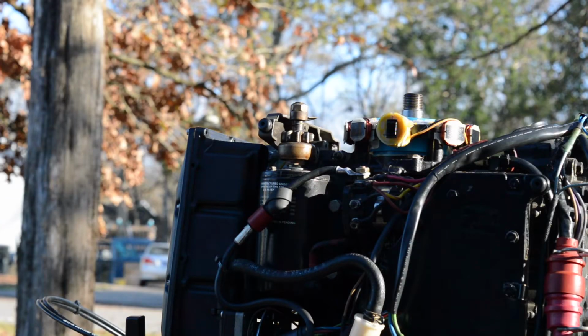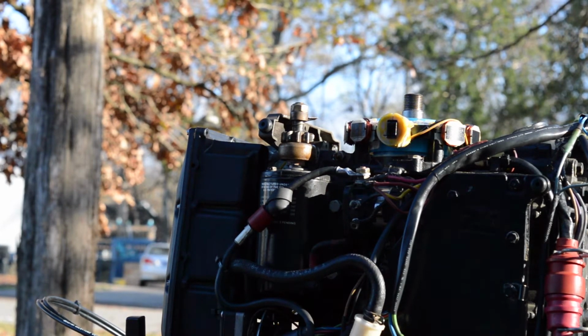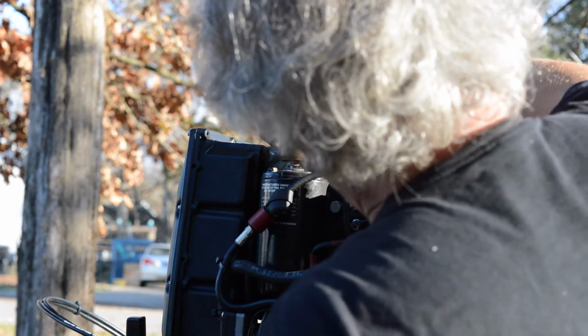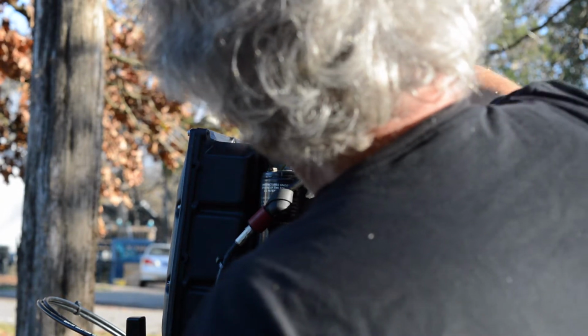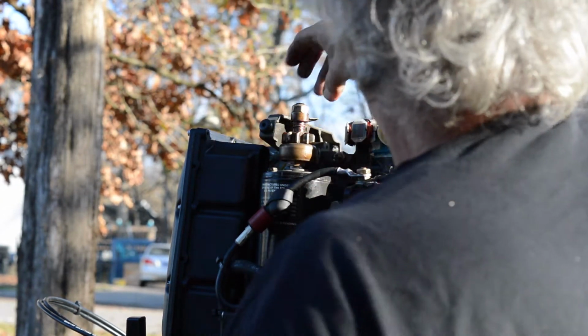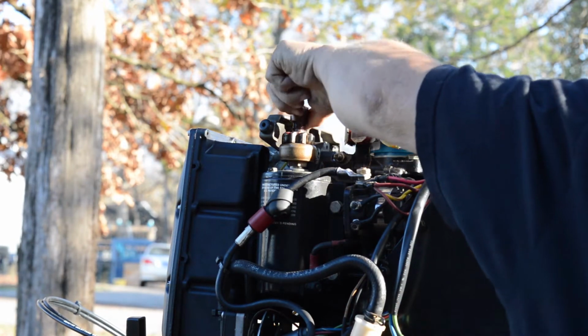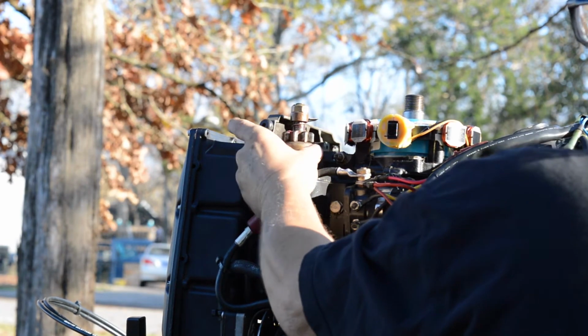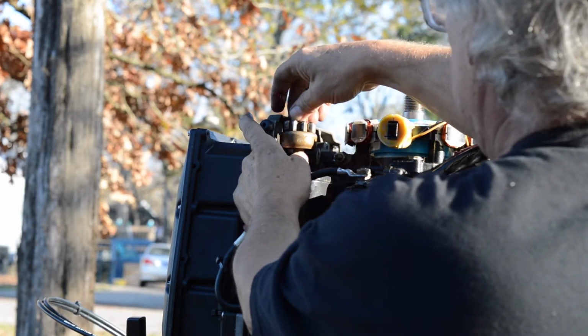If anything, you could put a little bit of grease right here, which I will do. Probably the anti-seize will work too. Okay, so sometimes when them starters are doing that, what you want to do is just get you a little grease. Yeah, because you're not supposed to grease these, but you can grease like here. Just not up here. Just make sure this bearing is nice and free. And then, if you can, work your Bendix up and down.